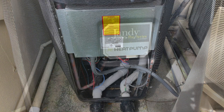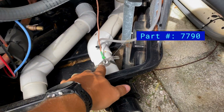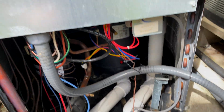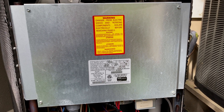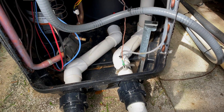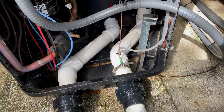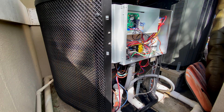We have the front cabinet door off. This is the offending sensor that has failed right here, and this is the electrical box we're about to get into. At this point, cut the power off, pull out the disconnect, cut the breaker off, and shut the pump off so when we remove this we don't have water gushing out.